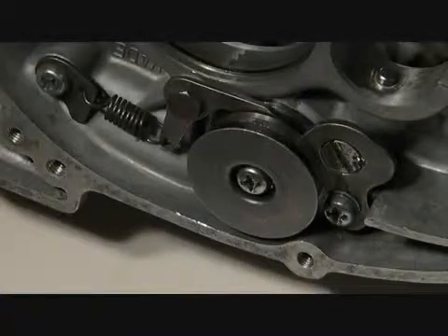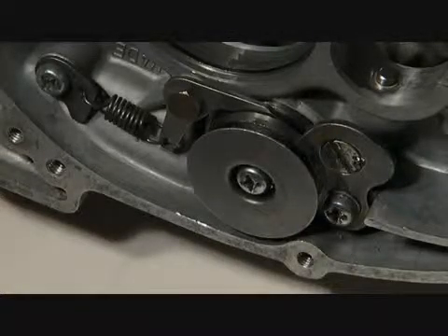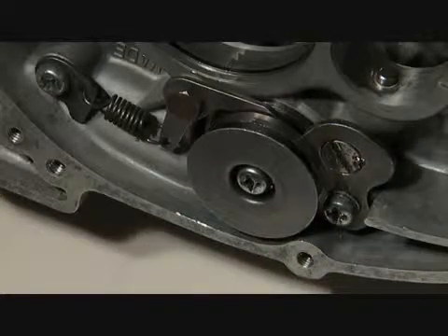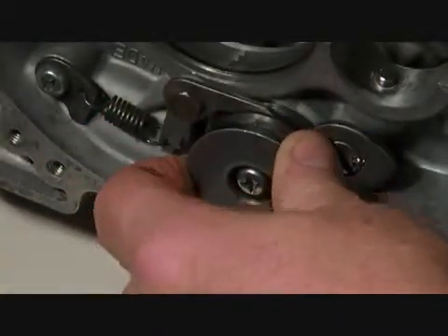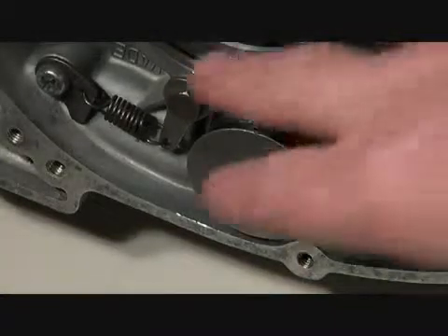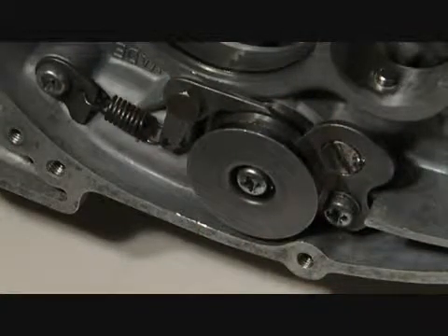This video covers the installation of the shift drum, shift forks, and transmission. Not a difficult procedure, but a few things you have to look out for or you can break or damage parts. The main part here is the shift hold-down — this holds the drum in a specific position for the gear. This arm pivots on the shoulder bolt. Some guys make the mistake of not realizing it's a shoulder bolt, tighten it down against the arm, and then the arm can't move, so the transmission doesn't work properly.